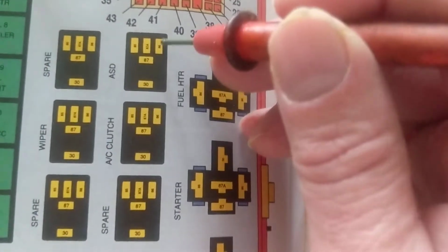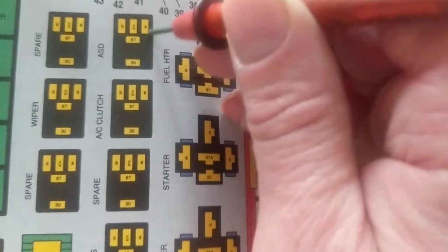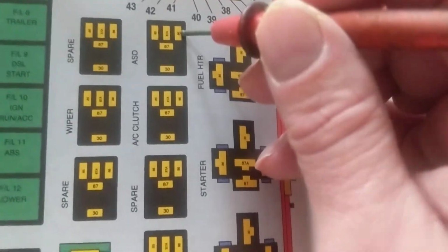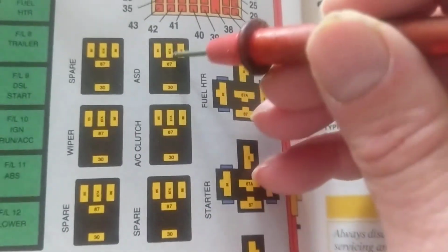However, that piece of solder breaks very easily. Once I put the relay on top of the terminals, it breaks the solder, and then you might have solder going across terminals, shorting out terminals. Not a good idea. Other option, I could take a piece of wire, like this piece of wire, strip it, and put that in there.